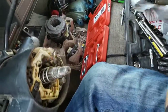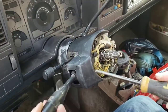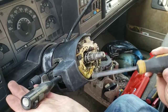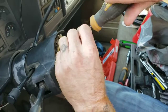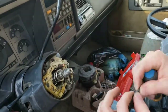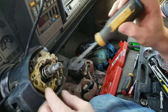So now, is this little black plate right here. You got to take it off. It's the lever for the turn signal. When you put it back on, you got to make sure that you hold the turn signal up. Put it back. So there's one screw. You can leave the screw in there if you can. That way, in case they're different, you'll know what part went with what screw. Alright, and there's 3 more for this turn signal assembly.